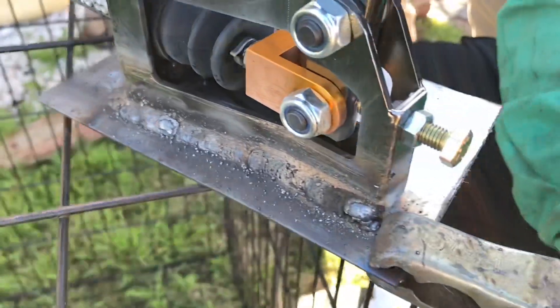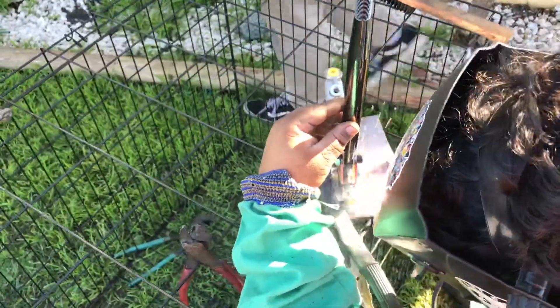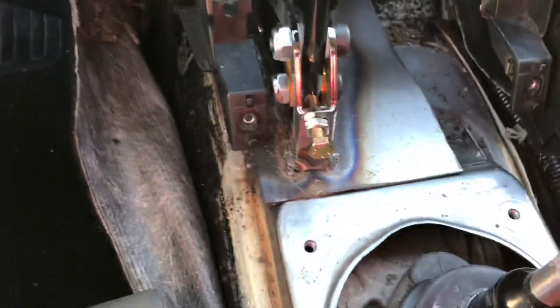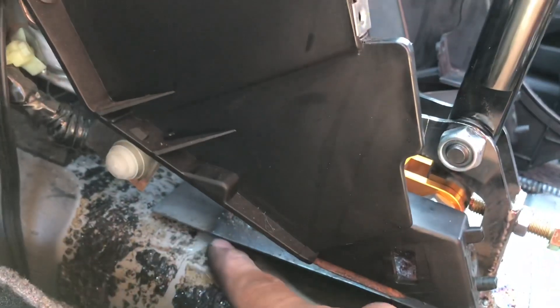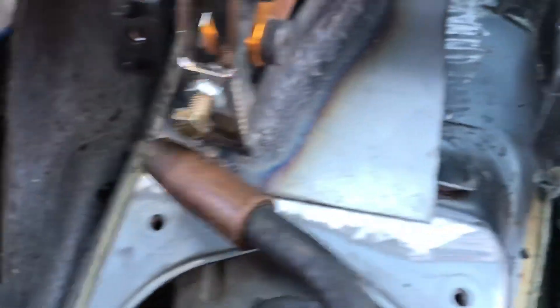We got one side all welded up — not the prettiest welds but compared to how they used to be, pretty good. We're gonna weld this in the car first, then paint it up. We got the sound deadening off over there and a little bit off the corner. We're gonna grind it down with the angle grinder to get a fresh surface, and then that's gonna sit right there. It gives us a good surface to weld on the back and the sides — there'll be a little gap in one spot but we can weld over there and it should be more than enough to hold the hydro in. Everything's down to bare metal and the sheet is placed where it needs to be.